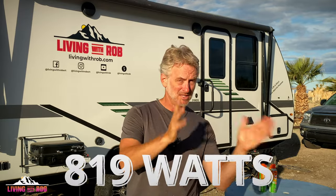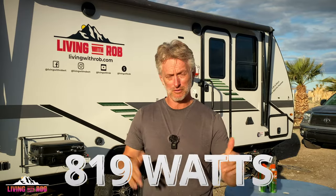I'm going to get in the desert sun here. I'm going to get about 70% efficiency once March hits. So you do the math, I'm getting 1170 watts times 70%. I'm getting a lot of juice flowing in at any one time. That's plenty more than enough to run everything on my rig all day long without depleting my battery.